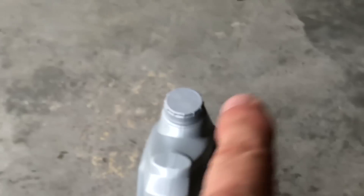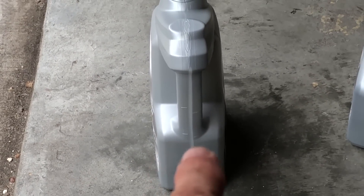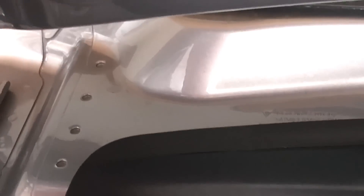Done with the first five quarts. Here's a helpful trick: instead of trying to pour the remaining two or three quarts and watch your measurements carefully, it's a lot easier to pour this bottle into the empty bottle and fill it up only to the two-and-a-half quart mark. That way you don't have to worry about overfilling. You put in seven and a half quarts total, and then you'll be able to see where you are and add the rest. I have two and a half quarts here and two and a half quarts in the other, and we are done.